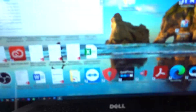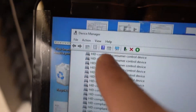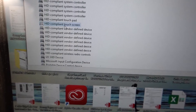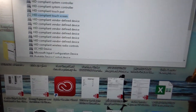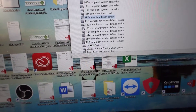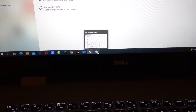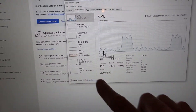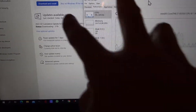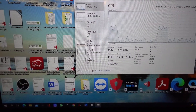Got it all booted back up and went into Device Manager. I found the touch screen listed there and disabled it — right-click, disable. So now it's not working. I want to see if maybe the mouse will start acting right. Seems like it's working okay now. I'm going to mess with it here for a little bit. Alright, I've been testing it for the last 30 minutes to an hour, and I guess it was the touch screen — because as soon as I disabled it, it's acting okay. I haven't seen that weird double cursor or the cursor acting really stupid.